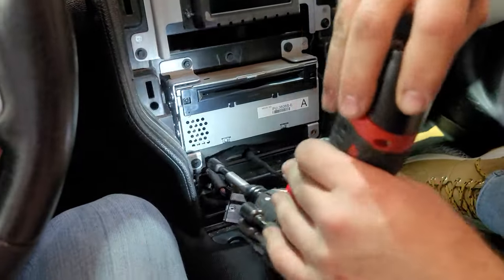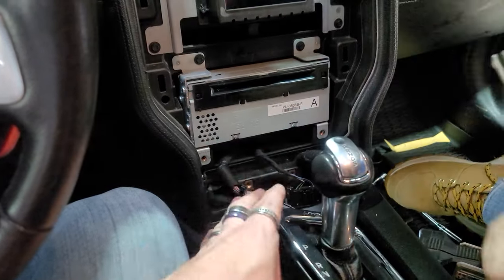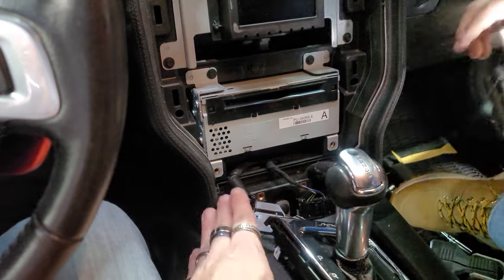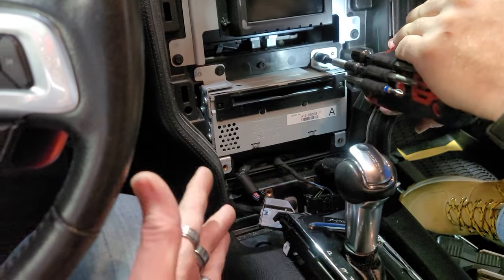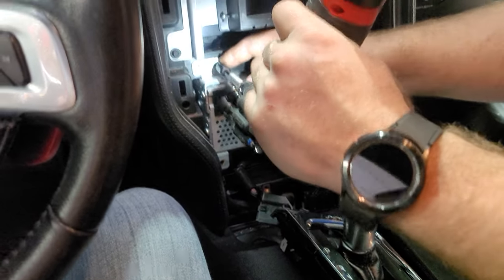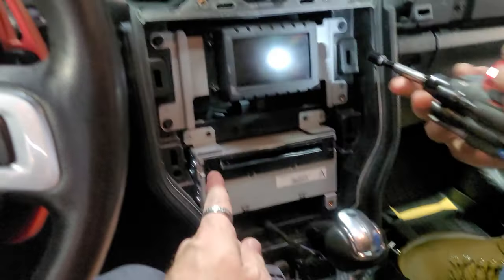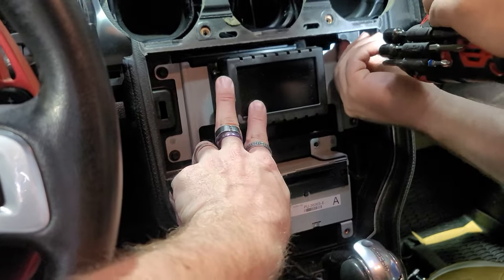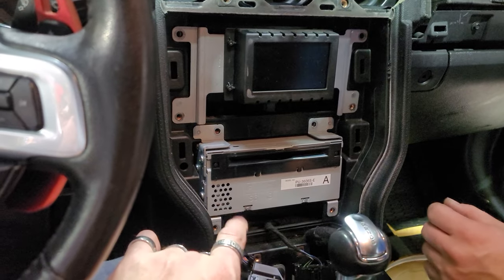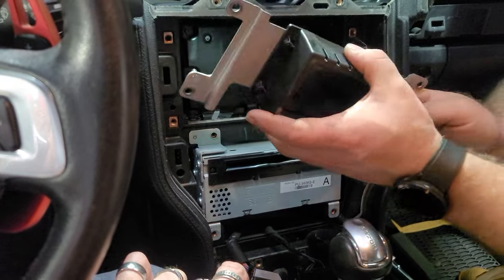In order to take the console out, the reason we have to do that is because that cigarette lighter gets hung up. He figured out a way to manipulate it — we took the shifter plastic piece out to gain us the room we needed and kind of flared it out to snag it. But you've got to be careful because it's going to be hard to get back in. Once we remove these eight 7mm bolts we're going to remove the CD slot and then remove the 4-inch screen. Pull that bad boy out and then we're going to unplug it.